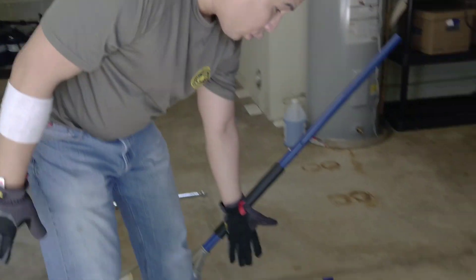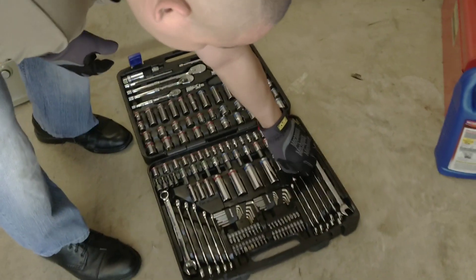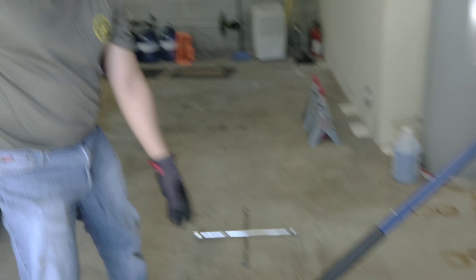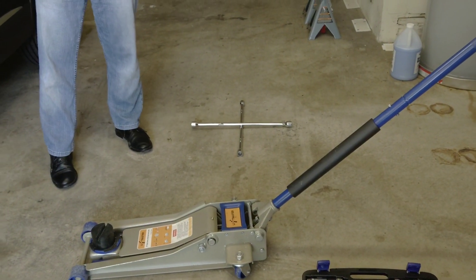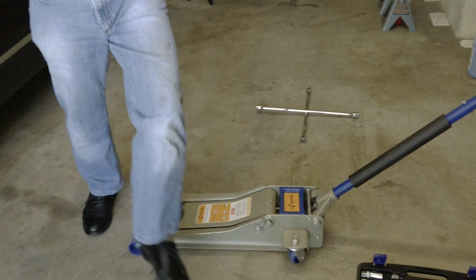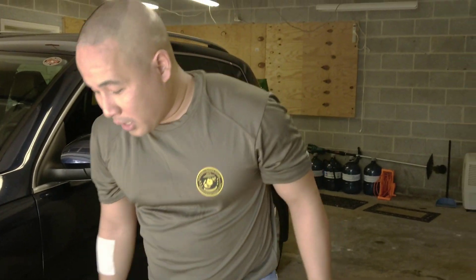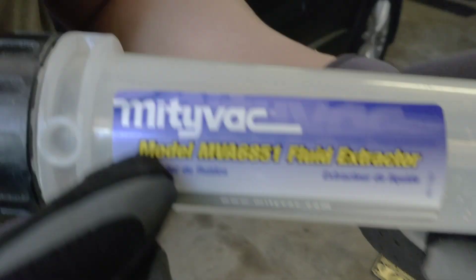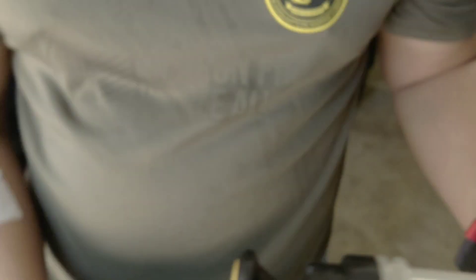You may need four bottles of brake fluid. You also need tools — a socket, I think it's 7 millimeter. You need a jack and something to remove the tire. Also, you need what they call a Motive fluid extractor.